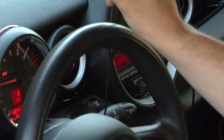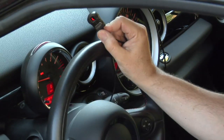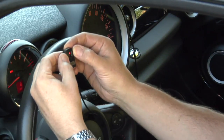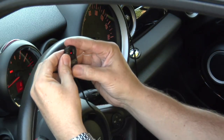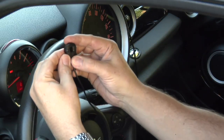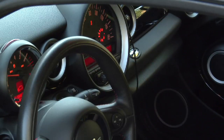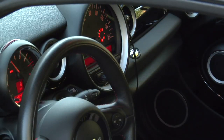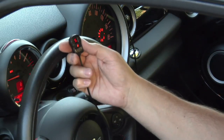To deactivate the pedal lock, we're going to do basically the same thing — hold both buttons for three seconds simultaneously, wait for the dash, then enter in each number of the PIN, pressing the bottom button after each digit. Now I'm unlocked. We'll start the car, set it to one of these settings, and give it a shot. We've got really good acceleration — we're on number 6 on the red mode. As you can see, we have full throttle control again.